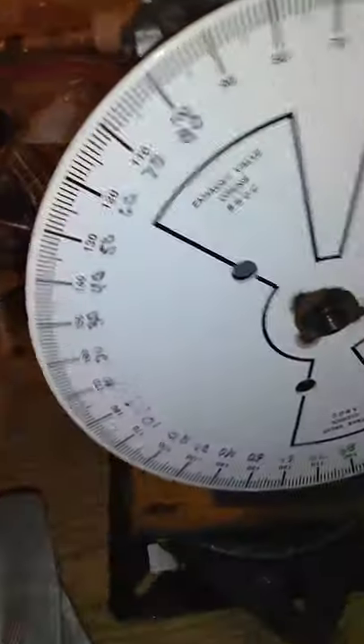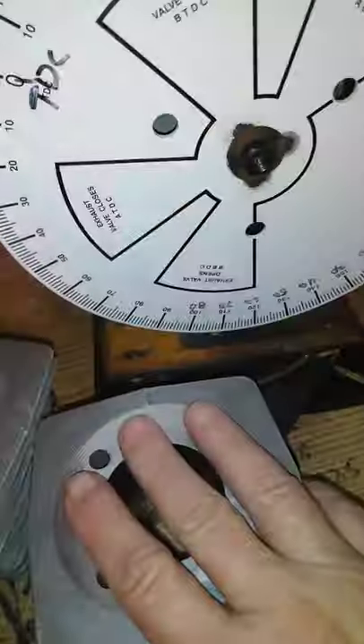There's a million ways you can approach port shapes. Exhaust roof port shapes matter — a flatter roof and a clean opening is always going to be better for peak power. At 33 millimeters wide, that's 70 percent of the bore. Sometimes I leave the transfers closed. I've machined them — you can only get seven degrees total from machining before you start blowing through the outside. You've got to commit and choose your duration. I look at blow down percentage, exhaust duration, transfer duration. Always check your squish at your wrist pin — it eliminates piston rock.